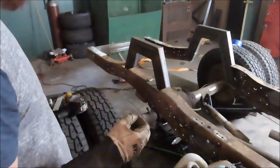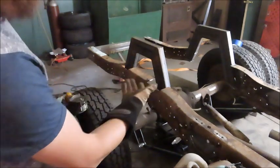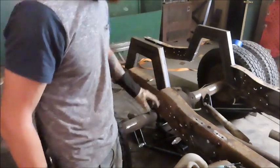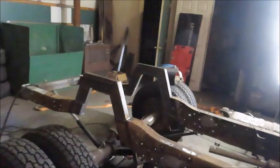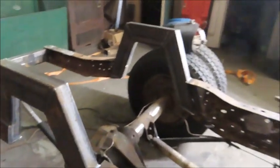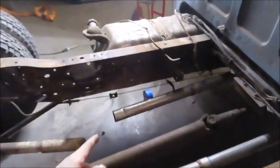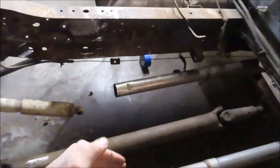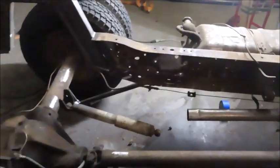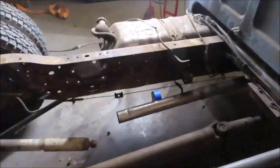My cut came out pretty darn perfect — this is how you want it. I'll trim these corners and then clean up everything and weld it up. Sorry about that — the battery died on my camera and I had to let it charge before I could film anymore. But as you can see, I've got both of the notches installed, fully welded up, and looking really good. Now I need to build a crossmember — it goes from that side to this side and then I have to notch the crossmember so that the driveline has a place to go. Then I can lower the truck, reset the pinion angle and everything, and do the upper four-link bars.